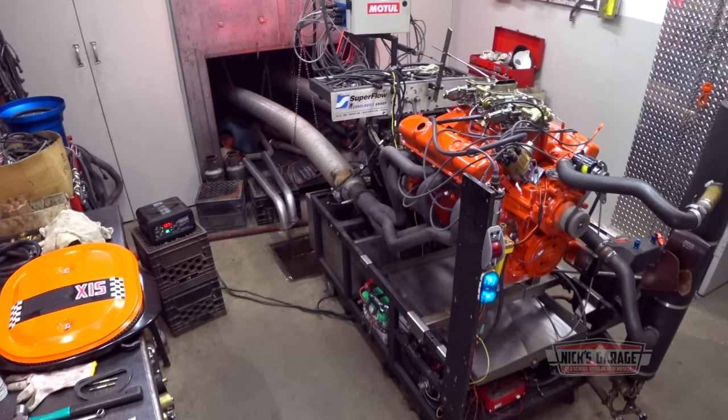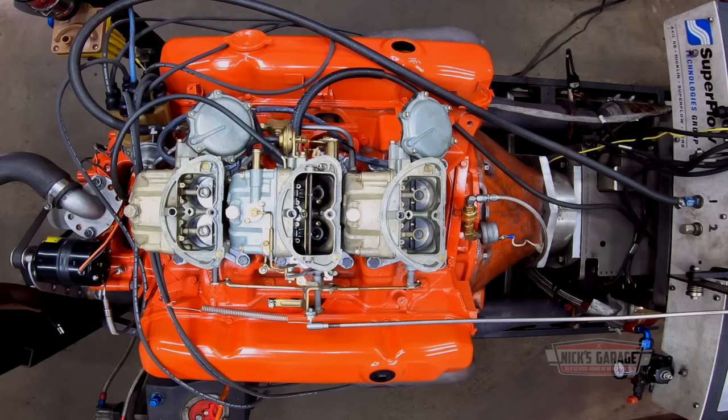That car's gonna be nice. It sounds good, eh? Yeah, the engine sounds beautiful. And it's going to go in an amazing little car. It's a stock clip. You know what's good about it? It looks like a stock 383. Yeah, that's good. Factory cast iron heads. They're late model 452 castings with the hardened seats that could accept unleaded fuel. The 906 castings, I have them in the back, which I could send back to Australia if he wishes. But in the meantime, you can run unleaded fuel on this.